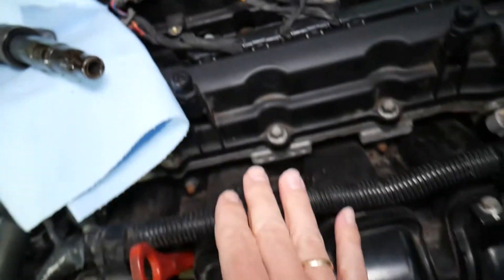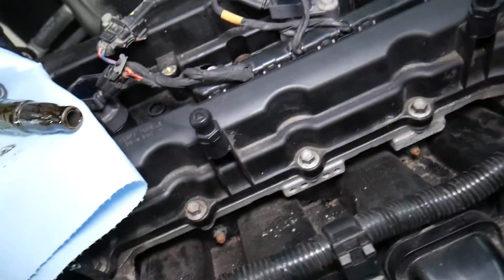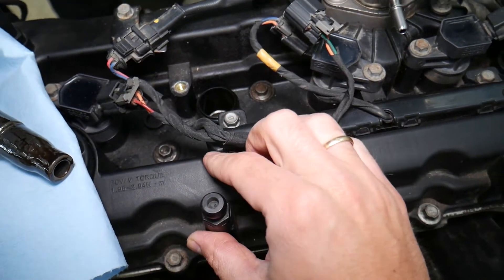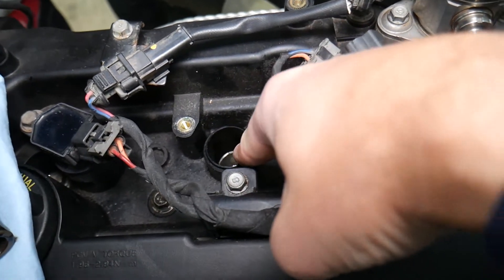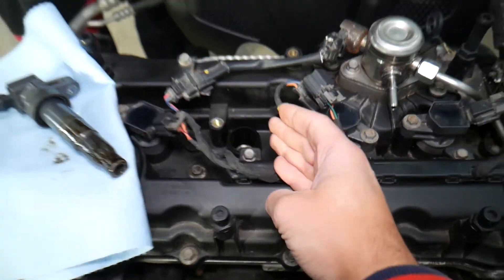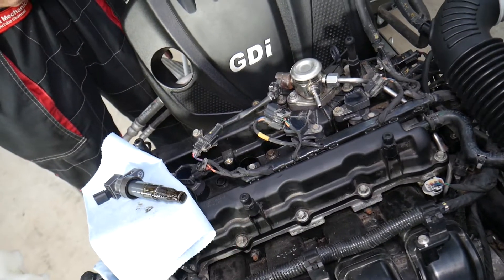You hope this is not the case with yours, but right there in that ignition coil hole there is quite a bit of engine oil. Here's what causes it: most people think the valve cover gasket only seals the outside of the engine, but there are internal gaskets — rings around the ignition coil holes where the spark plugs are. This is a 16-valve engine with two camshafts, and in the middle there's a seal to prevent oil from dropping into the spark plug well. Over time, heat causes that rubber to compress, lose flexibility, and harden, so oil starts dripping into the spark plug wells.